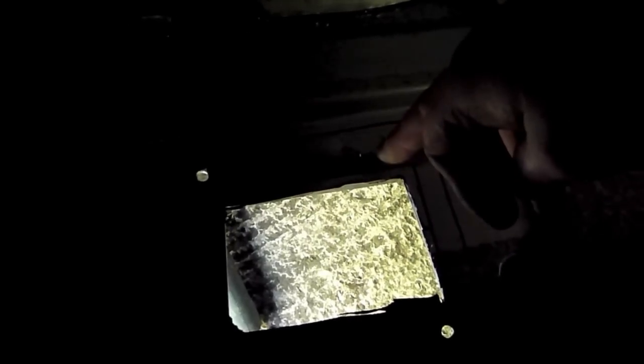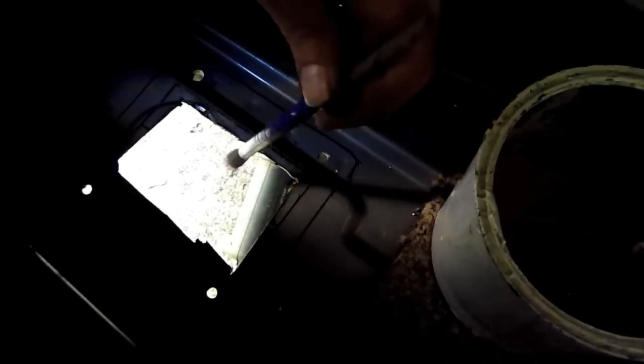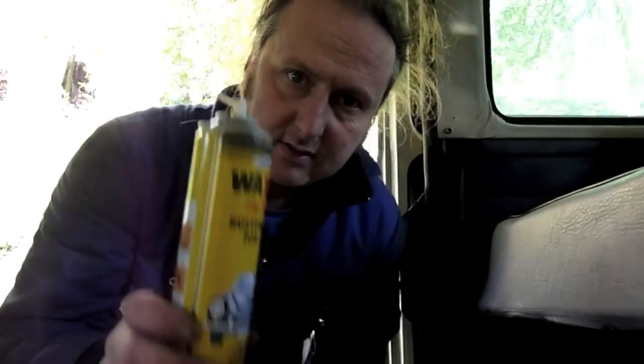There are the mounting holes drilled out. You can tell when setting out for this - you can see where it's welded, the floor pan, the cross member. You don't want to go any further towards the back of the van than we already have. Just painting the bare metal so we don't get any rust coming through on Tony's van, otherwise I will be in trouble. I'll let that dry then go around with the wax oil just to make sure before anything goes on there.